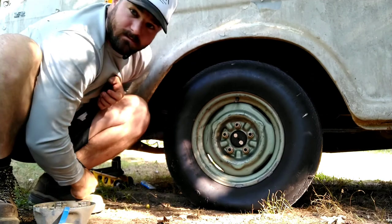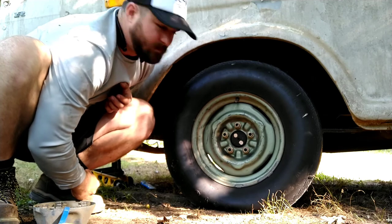Just like that — sitting on its own four feet. There was a leak in the tank I showed y'all. It's right there in the middle, and I've repaired it with a self-tapping screw with a rubber washer in the hole, plus fuel tank sealant with fiberglass mesh over it. We're hoping that's going to hold — it seems really solid right now. If so, that'll be the permanent fix. Why would I buy a new tank when it's just got some surface rust and really doesn't look too bad? Let me know if y'all think I'm crazy.